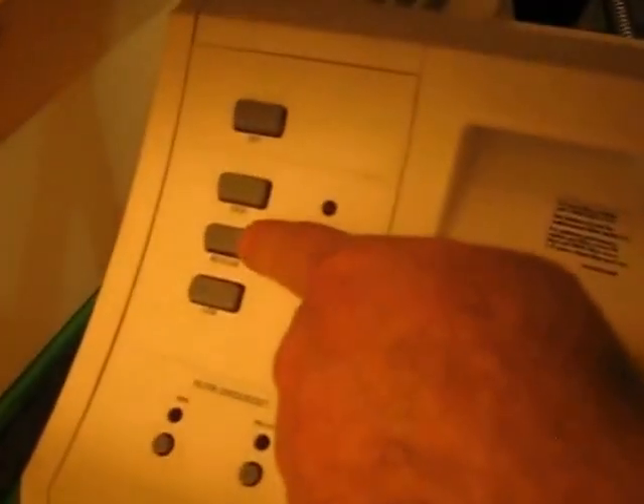You want to match the power settings between the two units. You don't want to blow the lower one at full steam while the IQ Air is on low power, because then you might blow dust off the bottom of the IQ Air filter. So match the airflow — have the lower cleaner blowing close to what the IQ Air is sucking in. Generally I put the lower unit on medium and the IQ Air on level five, which is almost full power out of six levels.